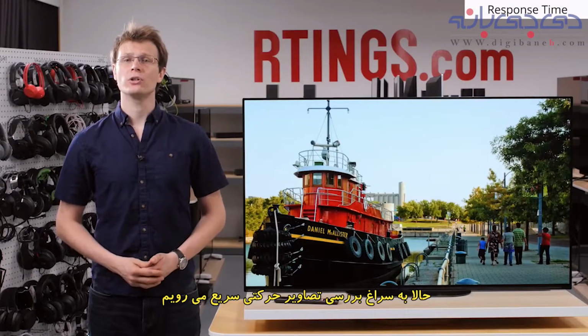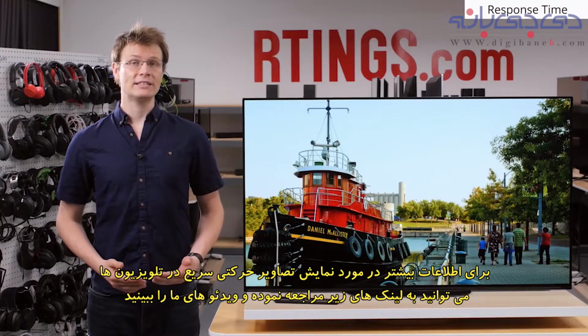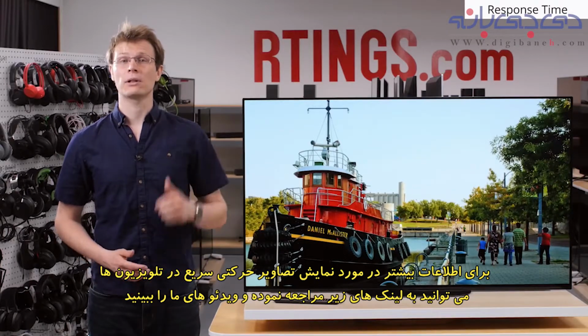So now for the motion. To learn more about motion on TVs, check out our video series, which is linked below. OLED TVs like the A9G have an almost instantaneous response time. This results in very little blur following moving content, as most of the blur is the result of persistence from sample and hold of the image. This fast response time is great for gaming and watching sports. Unfortunately for low frame rate content, this also means that there's no blur to smooth between frames of low frame rate movies.